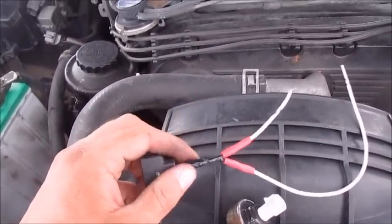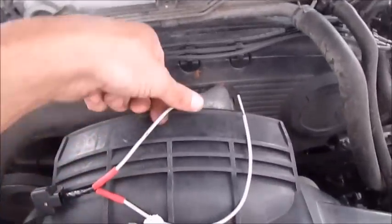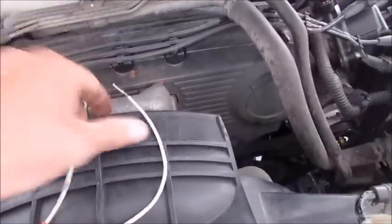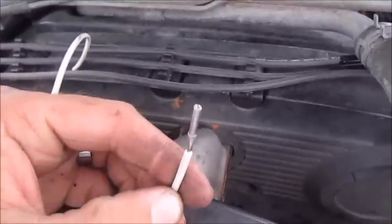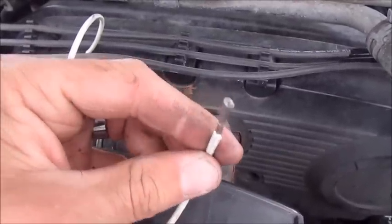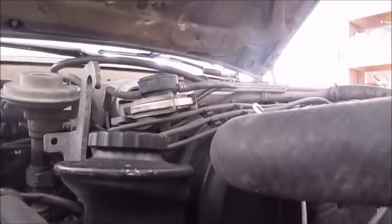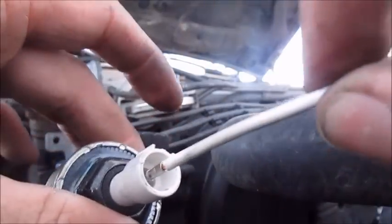Here's the actual plug that I pulled off the harness — I cut the harness where it goes down to the knock sensor. So here's the plug so I can actually plug it in and have a little bit of a factory look to it. When you pull the actual harness from the knock sensor, you have a single wire and then around the outside a braided wire just for the ground. I put the braided wire into this wire here, and this end piece connection is a Deutsch female connector. I actually used to work for Caterpillar — it's one of the pins and connectors that Cat uses. That sensor has a single pin inside, and that connector slides perfectly on there and is quite snug.